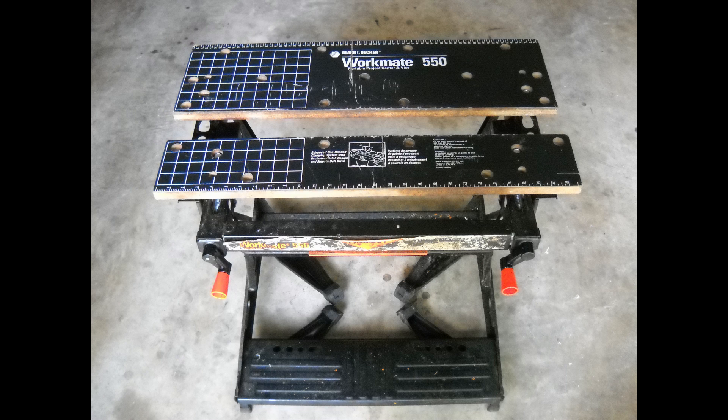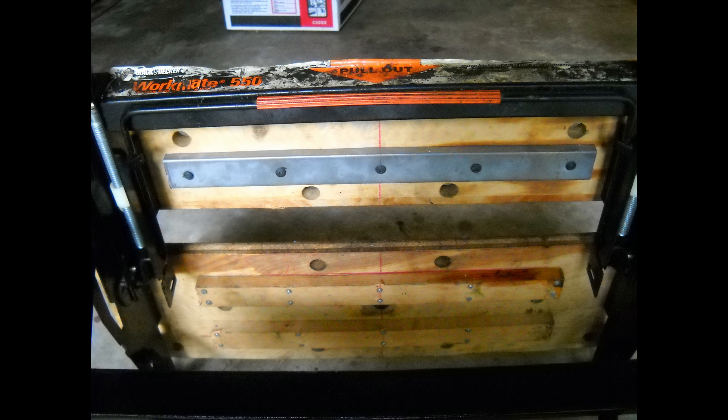In regard to your workbench, I consider a bench with a slot in the middle to be an absolutely mandatory item for making the job work and avoiding any potential problems with reassembly. The Black and Decker Workmate I've got shown here is what I used to rebuild my transmission. The only thing you need to consider is you might want to strengthen the bottom of it, as I have shown here — I found out that a 150-pound transmission will make the wood sag pretty good and I was afraid it might break on me.